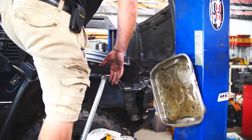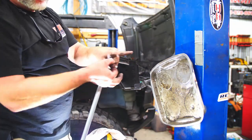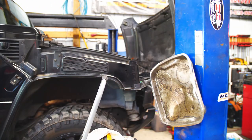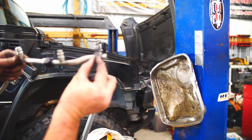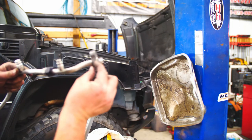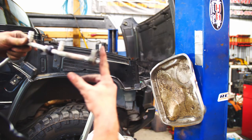Line's tight, but I just don't like the way it looks. You got a stud at the top, and the hose goes in. Here, I'll show you. You got the stud that sticks through the hole. This goes in, but you got this gap right there, so when you tighten it down, that's your seal. You see this gap, and it gives you a false sense of security that that thing is sealing. It almost makes it look like it's cocked.